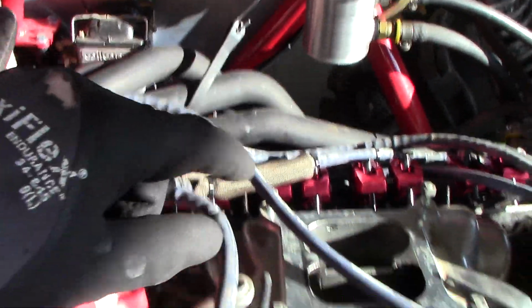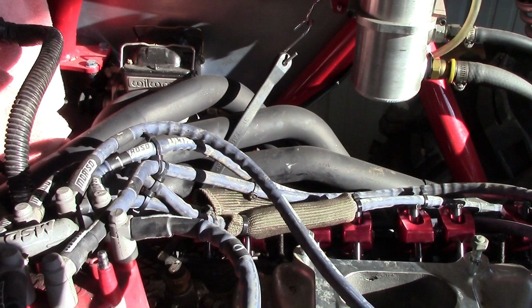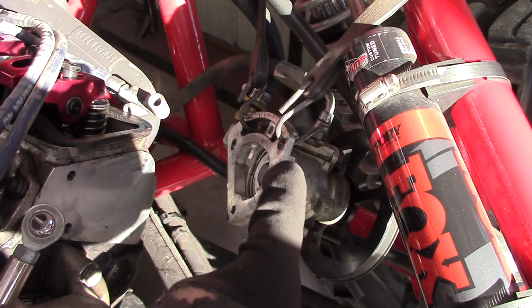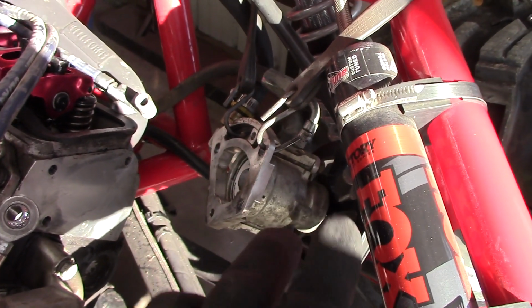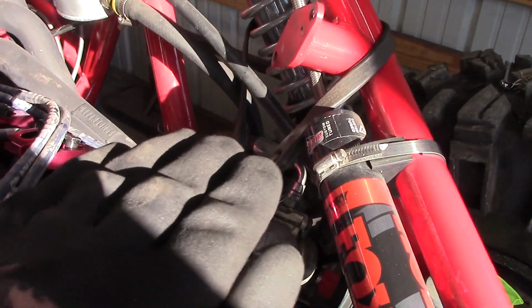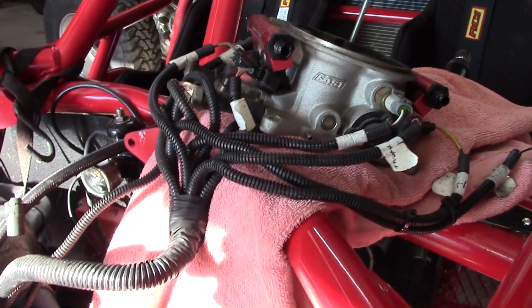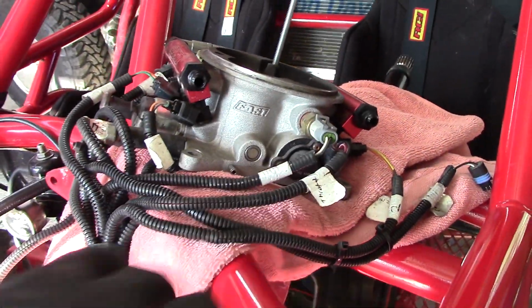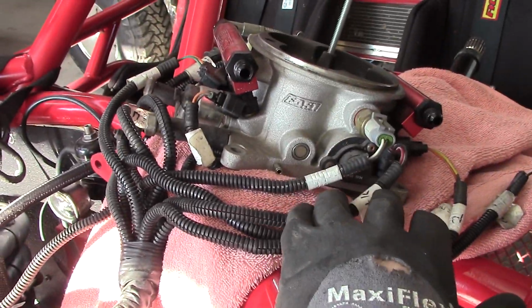So I've got it strapped up here, bungeed there, bungeed here. I'm thinking if I hold it at those 3 points, they can stay with the chassis as opposed to being separated. That was my power steering pump. I was able to strap that to the chassis and therefore not disconnect my power steering lines, so all my fluid is still intact rather than wasting my perfectly good Swepco fluid. I have the throttle body set up to where I was able to place it here and have that clear of pulling the motor, but I am like 95% sure I'm just gonna do a new fuel injection system.